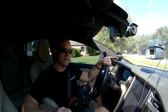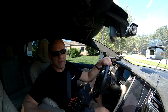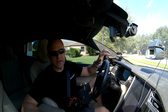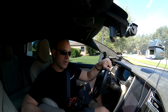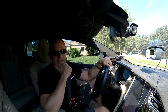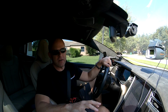It's definitely weird because you're not used to driving a Tesla with regenerative braking totally disabled, automatic emergency braking disabled, although you don't use that a lot, complete traction control off, and complete stability control off as well. Before, I've never tried this, but I've seen something posted online where you can pull fuses to get the car in this kind of mode. But right now, with a sequence of pushes on the screen, you can actually get everything disabled. So again, don't try it at home unless you're on a track or you have a lot of experience driving. While I'm doing this test, I'm being very, very careful.